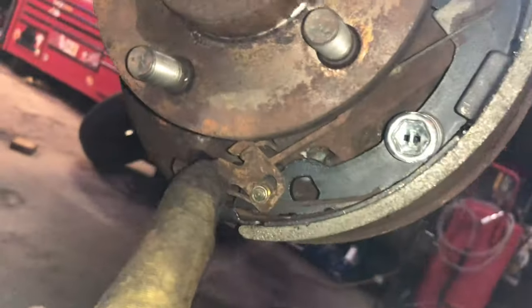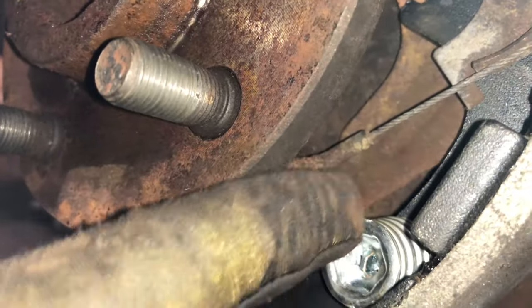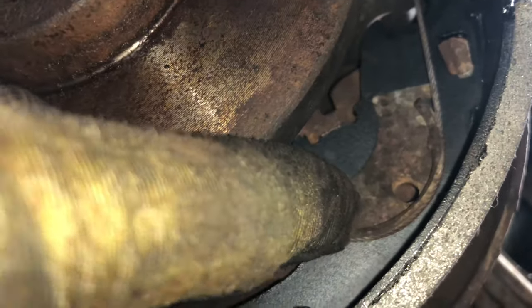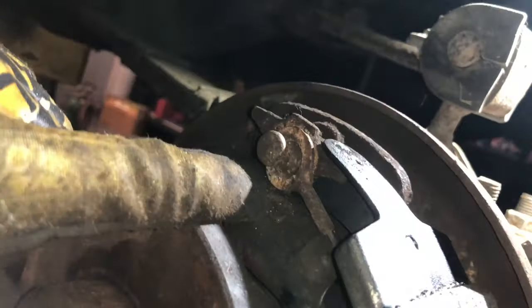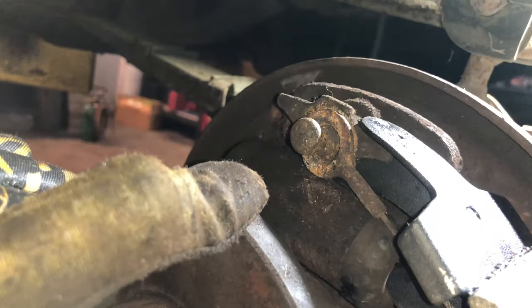Your cable that was hooked from the bottom, you're going to stretch it up after you've put in your springs. You're going to stretch it up back around your moon piece here. Now that piece actually pops out. There's a little dowel in the back that clips it in, and then it hooks back up on your top here. Now, we actually did not replace the cylinder on this.